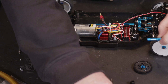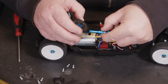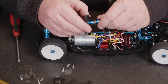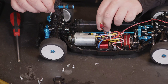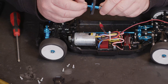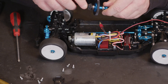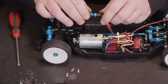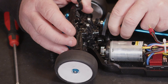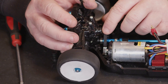We need the aluminium spacer. The drive pin you get with the optional gear kit is slightly shorter than the stock one. So we want the spacer, the new drive pin, and then we should be able to slide that gearing on — and we shouldn't have to change the actual pinion position or motor position. Then you want your bearing on, and your drive gear on.